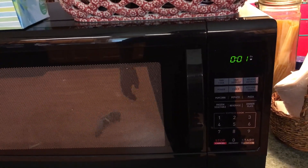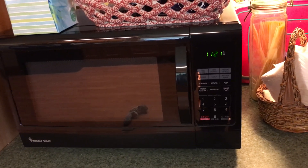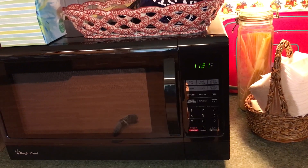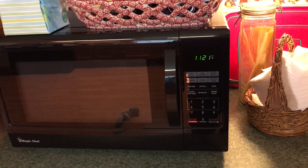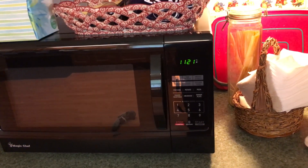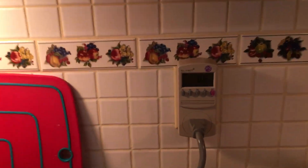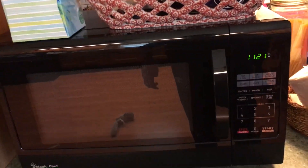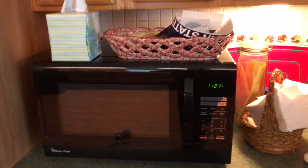Now you could probably run it on a better inverter with a battery that has surge watts up to 3000, but I would still think it would cut close on that as well, and would recommend in this case at least an 1800 watt inverter to power this microwave. So I wanted to do a quick test and you can see the wattage is back down to 0.5 — that's what it uses at idle — which seems kind of high just for keeping a clock lit and some memory settings. So anyway, there you go.